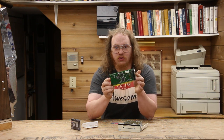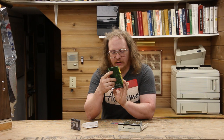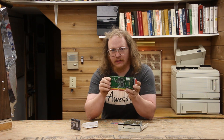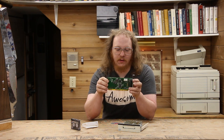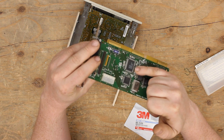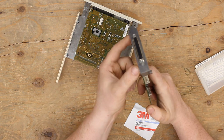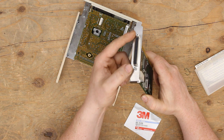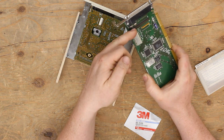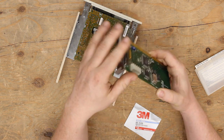But if you really did need the performance, there were products available. Colorado released the FC-20. This card still has a floppy controller on it — specifically the Intel S82078, a fairly standard single-chip floppy controller. Colorado also has their own dedicated chipset which handles the tape interface and probably hardware compression as well. These tape drive controllers also have an external connector on the back, which routes the internal 34-pin header, and DC power is brought into the card using the Molex plug on top.